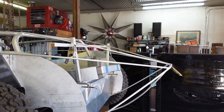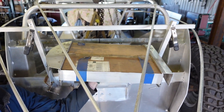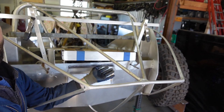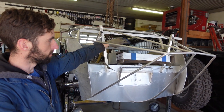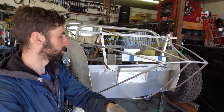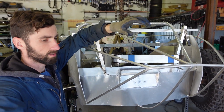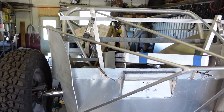It gets a little complicated in here. This is a radiator — it's got some cardboard on it to protect it, the sides are cut off. I was trying to use this on my '38 Dodge many years ago. It's going to mount flat about here. I'm going to expect the lower section to have openings, then a ramp going straight up to the radiator. Water will go in these holes a little bit, but hopefully it just flows back out and goes to the radiator to cool it. Then another ramp above the radiator, and a fan on top so the heat will siphon through and go out the top through some vent louvers.